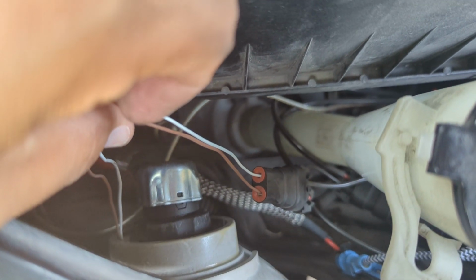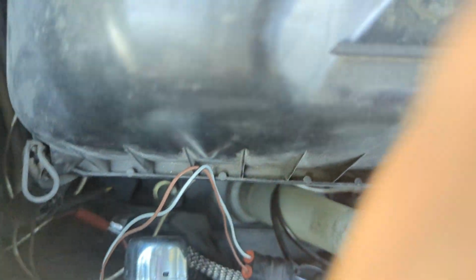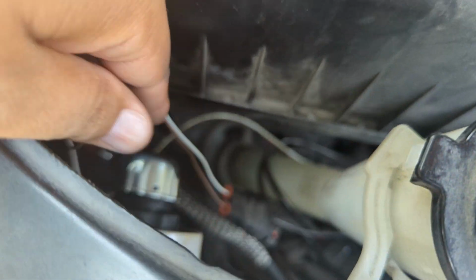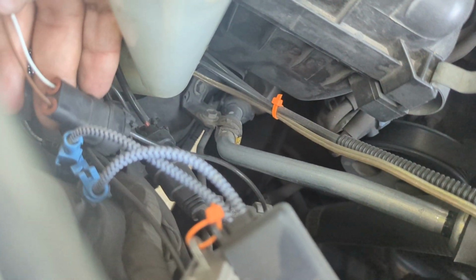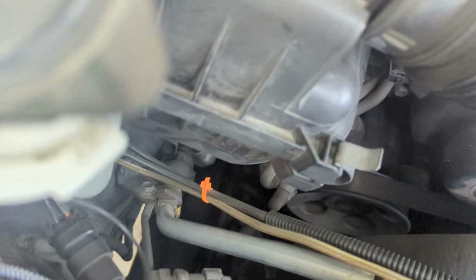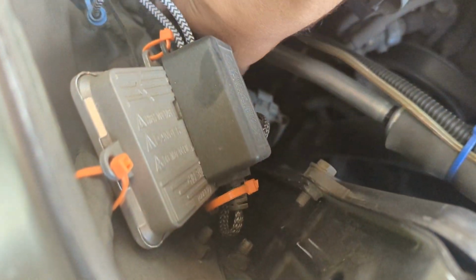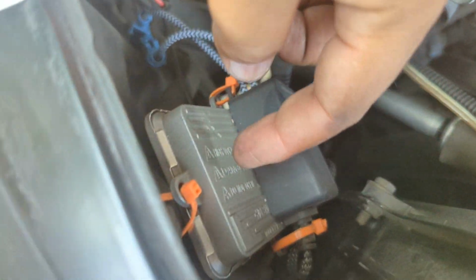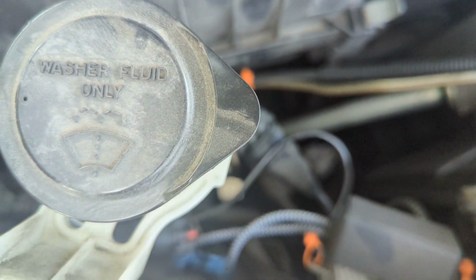And in regards to, let me get, I forgot your screen name right now, but this will be your shutter cables, your power and ground. I forget which one was powered on this one. Maybe we could get it from over here. So brown was power on this one, and white was ground. So I ended up just splicing it in and getting that to work. And then this is for the bulbs. So technically this plugs into the ballast, and then that gives power to this box right here. And then from there you just plug in your bulbs, and it'll be pretty straightforward.